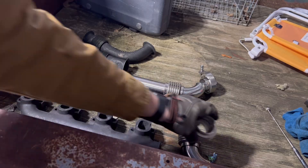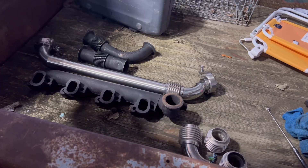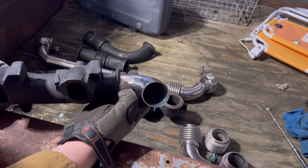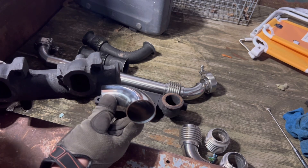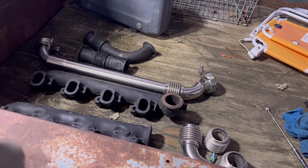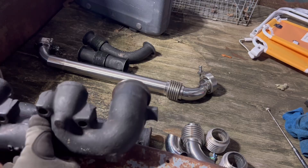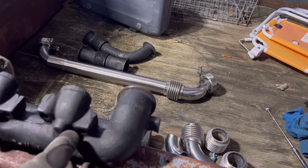Our driver's manifold already has this big beautiful elbow on it. Passenger side comes right off flat and square. What I'm thinking about doing is going ahead and just V-banding the driver's side like so and running that right up. I'll probably cut it off here and run it up tight close to the head, just like a Duramax one would, and keep them tight to the block. This thing though is going to have to go away. It's big, it's in the way, it's going to hit the firewall. This has got to go.